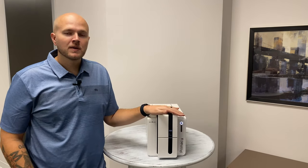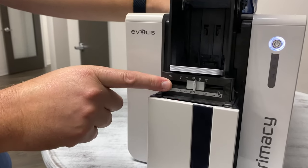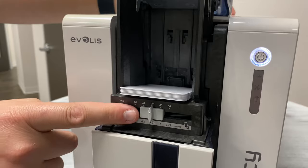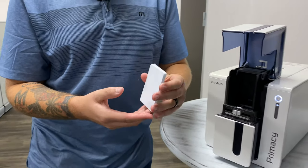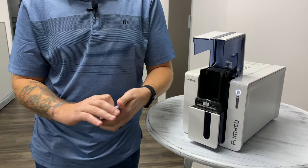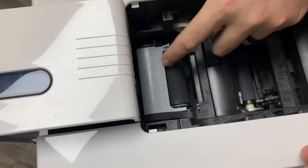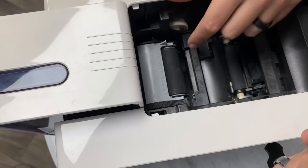The next thing we want to go over is cards not feeding into the printer. It could be a couple of different things. First, take a look at the gauge right here — these printers are meant to print anywhere from 10 mil cards all the way up to 50 mil cards, which refers to the thickness of the card. Your standard card size, which 99% of customers use, is a 30 mil card, so make sure that's set right there in the center. Next, when cards come out of your packaging, most of the time they have static between them, so we always recommend shuffling your cards a little bit, breaking them up, making sure there's no static causing two of them to stick together. Also, check inside the printer — open the lid and there's a cleaning roller located right here behind where it says 'gray cleaning roller.' Sometimes this will pop out, so make sure this roller is actually in the machine, otherwise you will have cards not feeding and you will get an error.